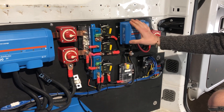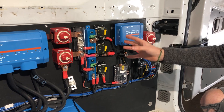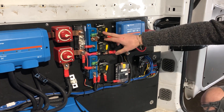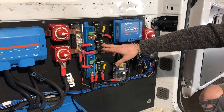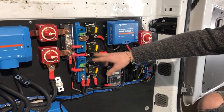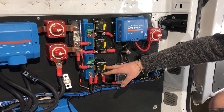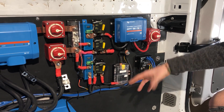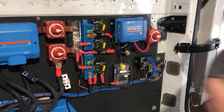We have a set of breakers. This is the solar breaker — after current from the panels comes in and we're producing power for the batteries, this 40-amp breaker protects the system and batteries. You can turn the DC to the solar charge controller off by flipping it. Right below it is the alternator charging breaker — a 200-amp breaker to protect the alternator current and batteries. Everything's sized for the source. Then the last breaker is the house load: anything running lights or off the DC distribution block. It's a 100-amp breaker protecting the loads and batteries.